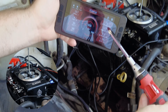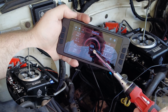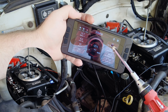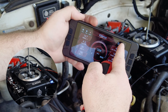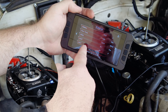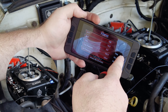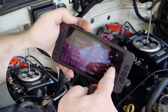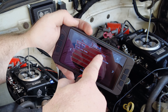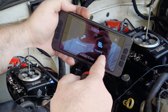The IAC position is about 14, 13, 10 — and we still got a high idle. There we go, that's what I was waiting for. It went up to its parked position. If we go over here to Monitor and Sensors, we'll see that our TPS is at 2.5 degrees and it's no longer in its closed position — it now says open.